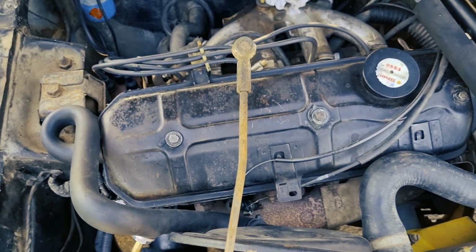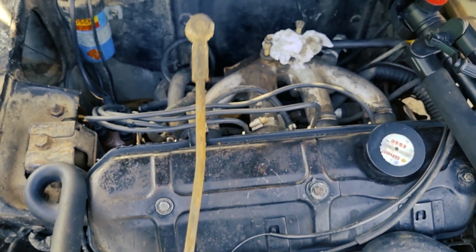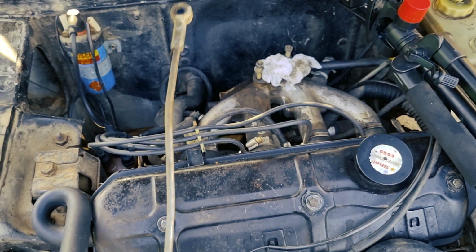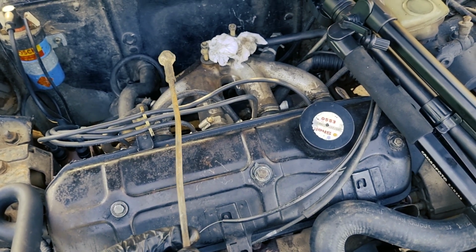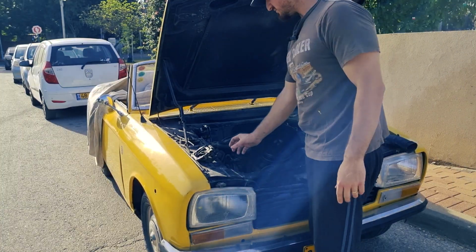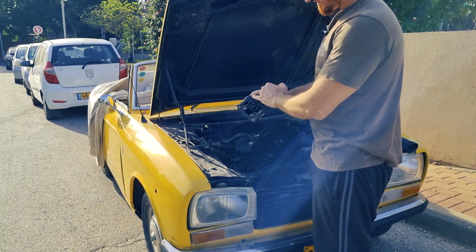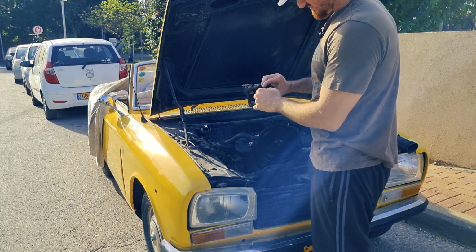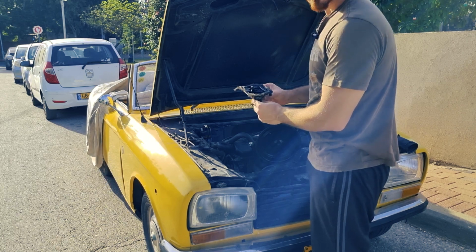So this linkage is twisted. It's deformed because force has been applied on it. It doesn't have the right angles, so it made the possible angle it could while deforming. Okay, so now zooming out a little bit, this is the mechanism. As you can see, they had a seal, but the seal is torn and it's not completely the right size and shape of the transmission housing.